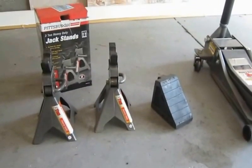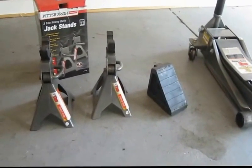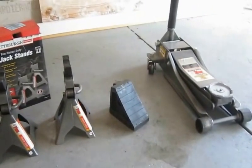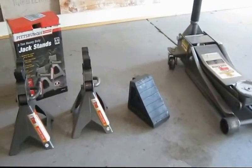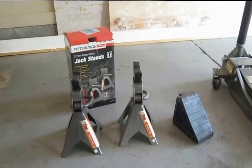Just please be very careful when you're working on cars — there are lots of areas that can cause problems. One thing you want to make sure: never depend upon your jack to hold up a vehicle. Get yourself some jack stands, maybe a wheel chock to hold the front or back tires. I use one; if you want to use multiple, that's certainly safer.